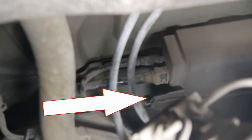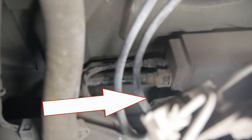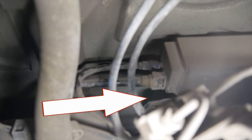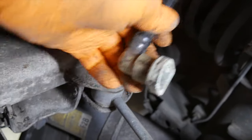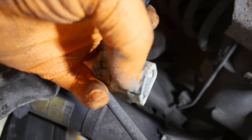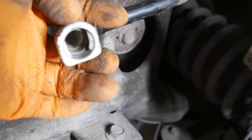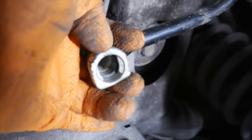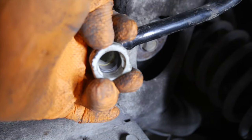And then it runs down to your actual charcoal canister there, and there's a blank nipple on the back side, on the other side of those two there, that you can reach by hand. And so here is what goes on the nipple of that evaporative canister, and it's very easy here. You'll see there's a little push indentation right here, and as you push that, that clip will expand there. See how it expands out, and then you can just slide it off of that nipple.